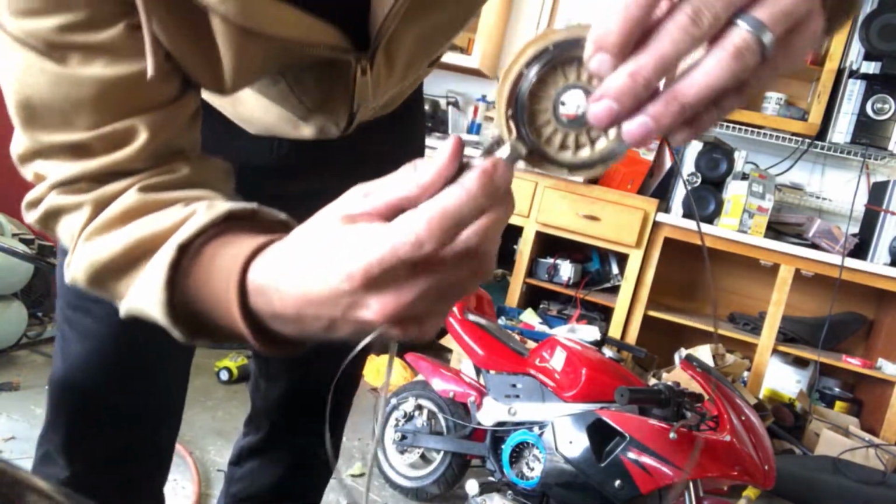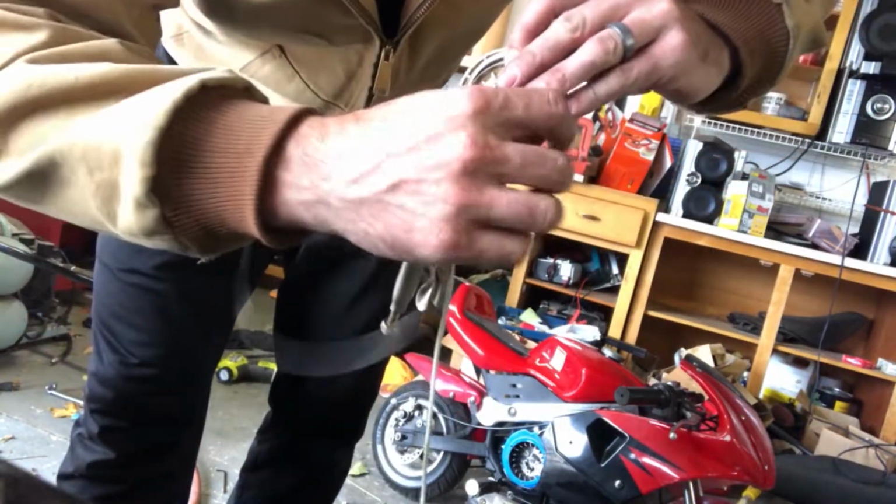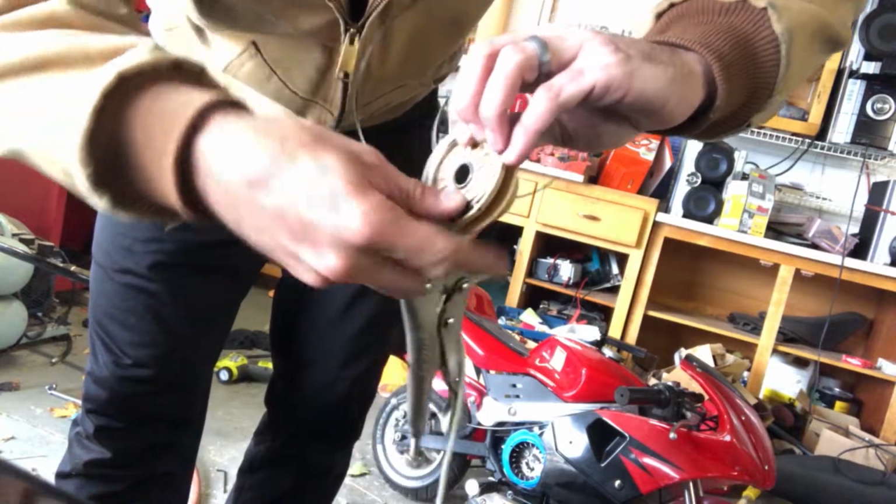All right, so I need to wrap this coil up tighter. So I'm just going to coil it inside here, slowly and carefully, around and around, making sure it doesn't pop back out. Oh, it keeps popping out. All right, so in order to rewind this, I clipped the vice grips right onto the clip here so it can't pop out. That's very important. When that pops out, the whole thing unwinds. And then I just work it around.